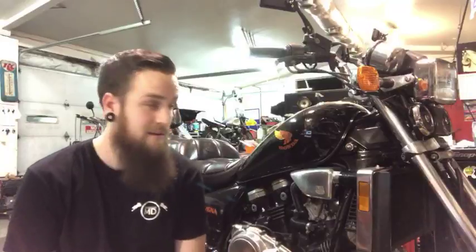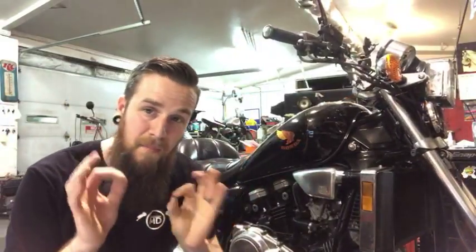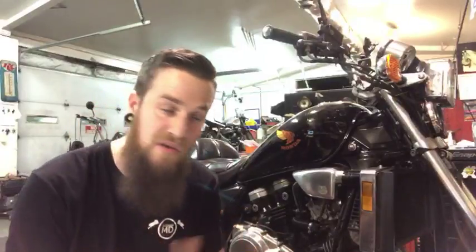Meandering, show the bike off behind you. It's a gorgeous bike, dude. I think I've already shown it off a couple of times, but mint is an understatement. This guy wants it to be perfect, and he always brings it to me, which is really cool. We've had to put a fuel pump in it off of a Suzuki Marauder, because you cannot find the fuel pumps for these anymore, and there's a certain specific wiring that goes to that fuel pump, and I found that the Suzuki Marauder fits perfectly. But it's a great bike, man. Really awesome power. The carbs are perfect.